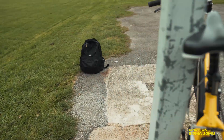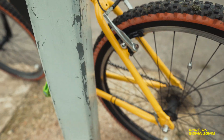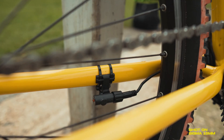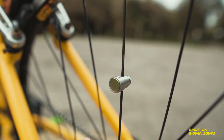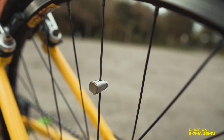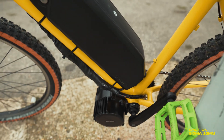The cabling around the bottom of the bike: there's the main cable for the battery, and then two others. One — which you may need to wrap around your chainstay — is for the speed sensor, which is a little unit that gets zip-tied onto your chainstay. You bolt a small magnet onto your spoke, and then in the display on your handlebars you input your wheel size — for instance, this is 26 inch — and you'll get an accurate speed reading. The other cable is for the gear shift sensor, which I haven't bothered with.